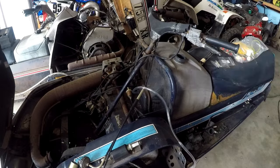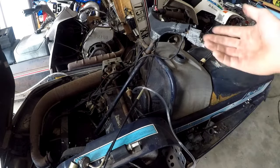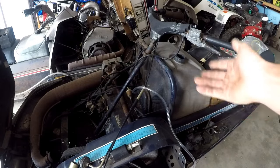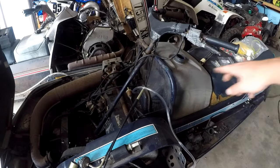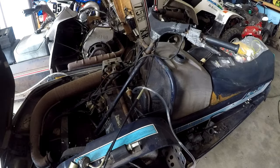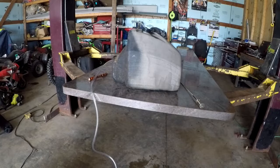This tank has been completely drained. I would highly recommend, if your snowmobile's been sitting and you're doing this — because if it's been sitting a while, the pickup tube is probably cracked off in the tank. What happens is that inline pickup tube gets super brittle and breaks off. I would recommend flushing out your tank before you even start putting a new line in if yours has been sitting for a while. In my case, I looked inside with a flashlight and I saw the old pickup tube was all busted in pieces laying inside the bottom of the tank.